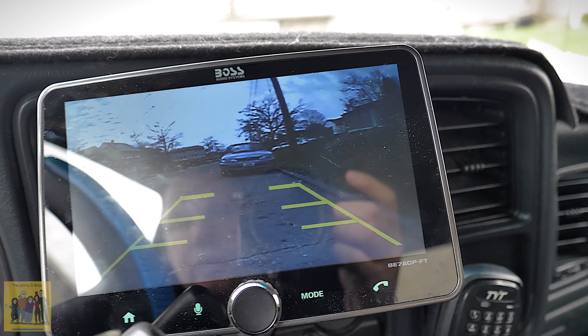Also, as I mentioned earlier, there's the lines. These are the lines provided by the camera. You're going to see right where the wire is attached to the actual camera — there's a wire that says something like 'backup lines.' If you cut it, these lines will go away. Go to settings and you can see it's the parking assist guide under camera settings. You'll notice when I have the parking assist guide on, I see double lines. So if you wanted to use the lines that come in the stereo, you would cut that wire for the parking assist lines on the camera itself. But I'm fine just using the lines on the camera. This is where you turn it off and on — it's under settings in parking assist lines — and you can adjust where those lines lie.